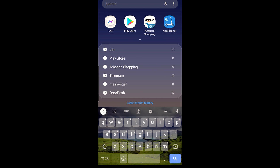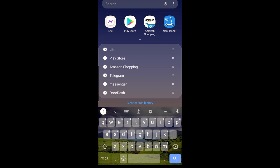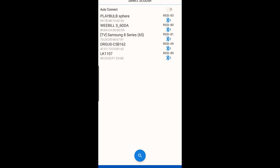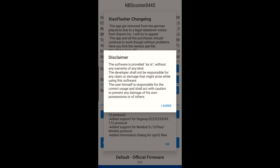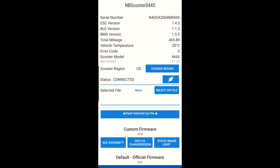Welcome to my phone. The first step in upgrading your battery to the 48 volt kit is updating the firmware in your scooter. When you buy the kit, the seller will send you a zip file with the firmware in it. You need to go to your Play Store and download an app called Xiao Flasher. Open up the app — this is me just turning on the Ninebot Max scooter like I normally would, and it should show up under Bluetooth. There it is: NB Scooter 0445. I'll click on that. It gives you a little disclaimer — software is provided as is with no warranty. Also, the app got removed from the German Play Store due to a legal takedown notice, but that doesn't relate to me since I'm in the US.